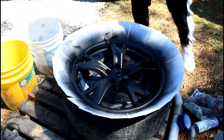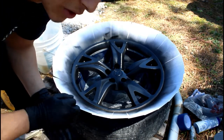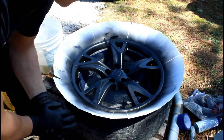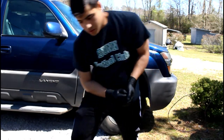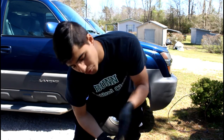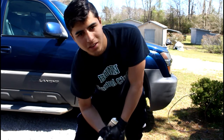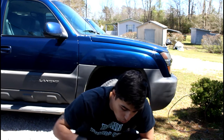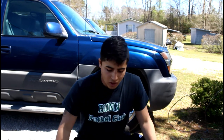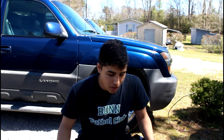On the next video I'm gonna reveal the surprise when the whole car is completely done. Stay tuned for the other wheels. To recap: you have to do four coats for the black base rather than three, because the next spray paint — the special color plastic dip — I'm gonna do another three or four coats on top. I'd rather just do four to make sure the whole rim is covered with no silver spots.